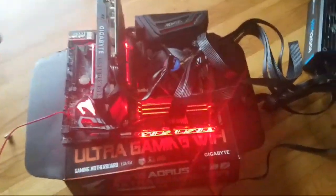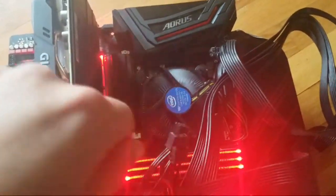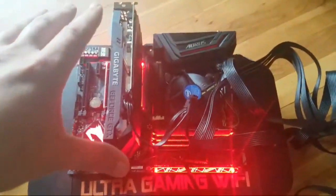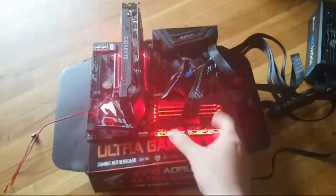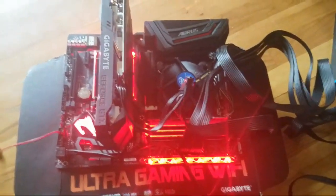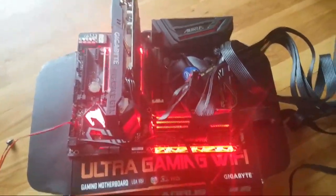All right, guys. Obviously, some of them kind of glow here. This is like a fancy one, man. Your fan is going because that's to keep your processor cool. Again, real simple. I don't know how much easier I can tell you. Like I said, in your tower, the first thing you want to do is screw your motherboard into your tower. You have 4 screws. And like this, you would probably want to get tempered glass, so this all shows. Maybe the kids might like that.